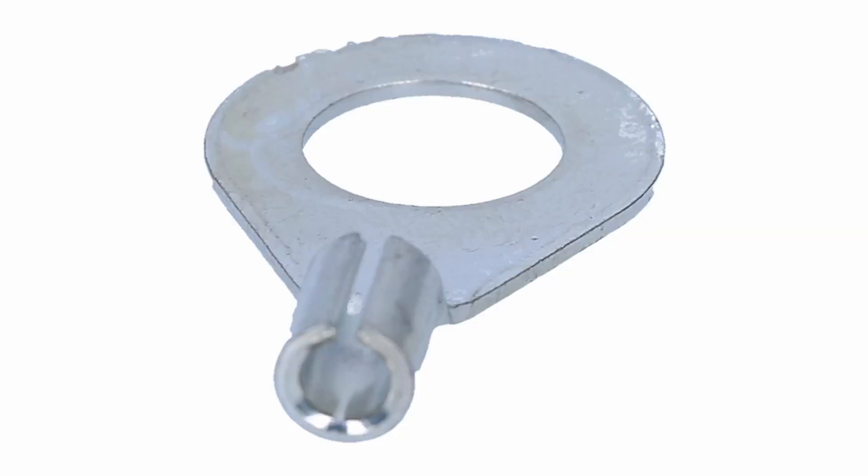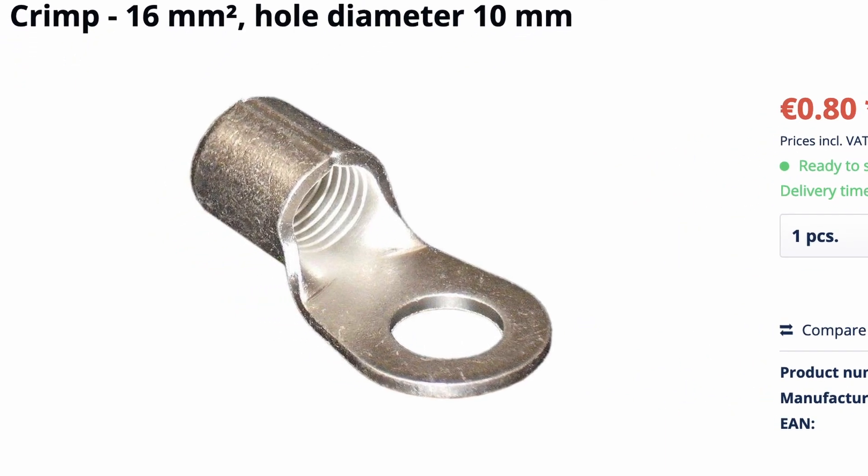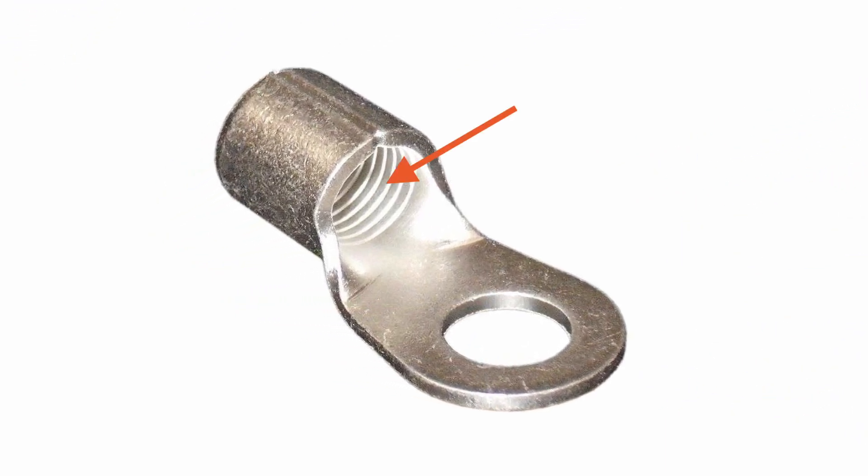There are other features to consider. On almost all those automotive terminals, you'll find on the barrel it's a bit of metal that's just folded over — there's a seam that's not welded. When you crimp on it, they can open up a little bit, and you don't necessarily get a very good crimp. So we want a welded barrel, and then there are refinements in a good terminal like little serrations inside the barrel for a better grip and connection.